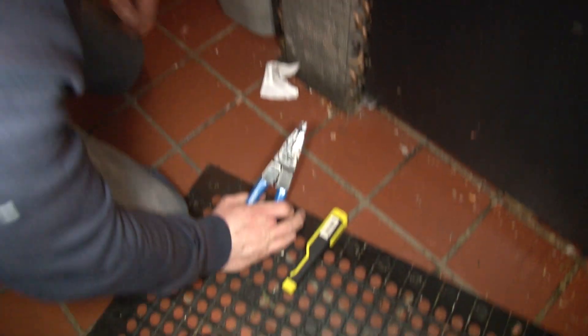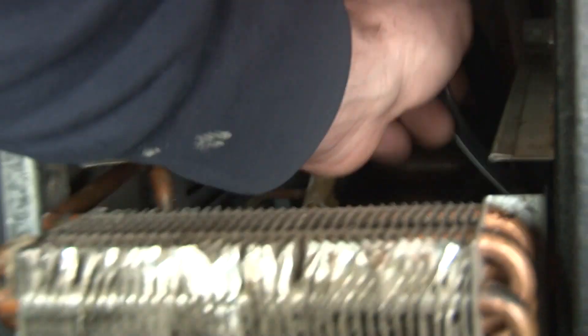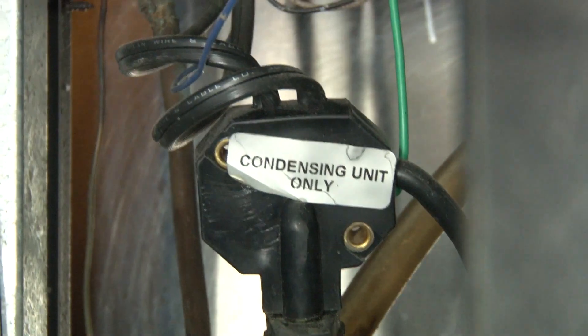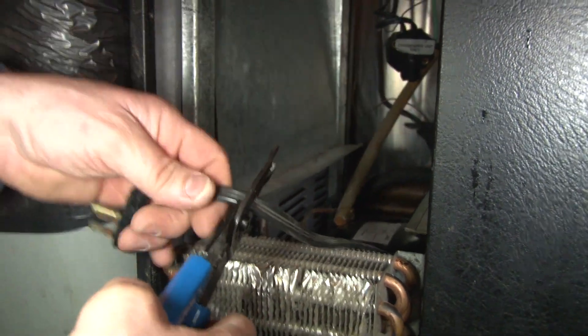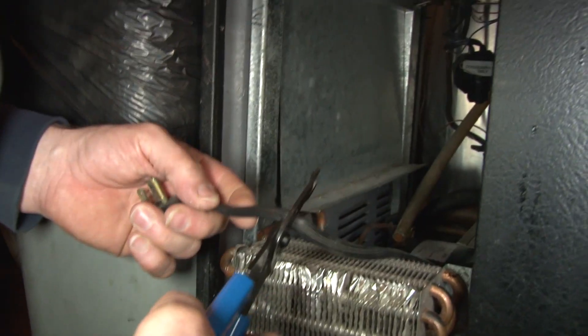Next step is to find the cord in here. It's right back there — this is the cord coming from the condenser that plugs into that switch box. And this wire up here goes out to the conventional cold control that we just jumped. Since we jumped those wires, that junction block now has power all the time — straight power, unswitched.